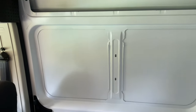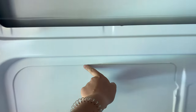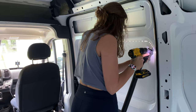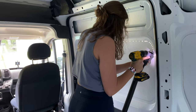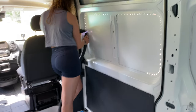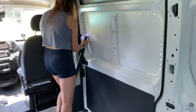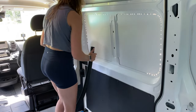When looking at the sliding door on the inside of your van, you will see the original manufacturer line. This is where you will be drilling pilot holes and cutting the hole for your window. Using a drill, make pilot holes around the entire perimeter of the manufacturer line so you know where to trace and cut on the outside of the van. I put more holes in the corners so I could get the curve right when cutting. I'd recommend holding a vacuum with one hand and drilling with the other to catch as many metal shavings as possible.